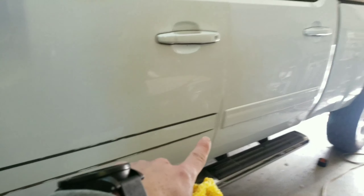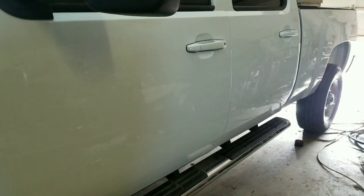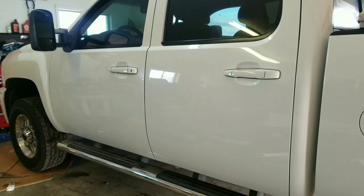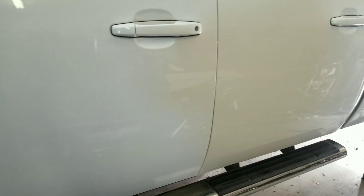And that is without the emblem. I'm going to go ahead and use the eraser wheel to strip all of this off, and then remove it and show you what it looks like when it's finished. Here's the truck with the siding removed — no more badges or grocery cart bumpers. The last and final step is going to be using the DA polisher and going over it with some fine polish. Right here — I don't know if you can see this line, the yellow line from where the badge was rubbing — I'm just going to hit that and see if I can get rid of it.